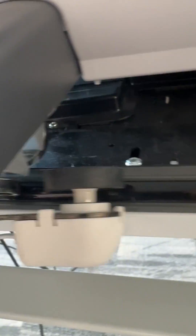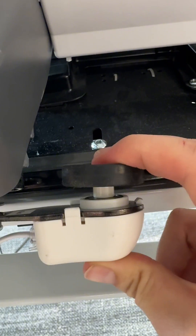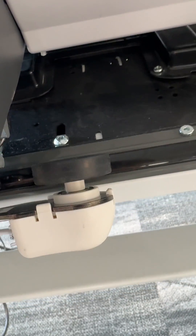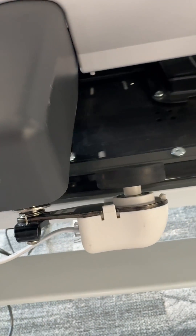You may notice the encoder isn't riding along the track all the way. It's still rolling, but it's more on the metal track support rather than the plastic tracks. To fix this, take your fingers and bend it back so it rides along the track. You can test this by moving the machine front and back and make small adjustments if needed. Now you can see that it's riding all the way.